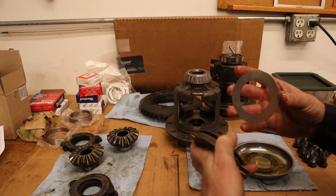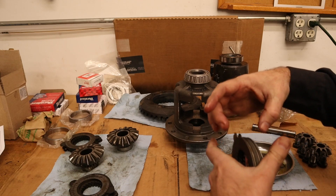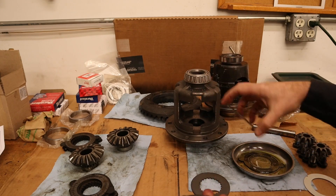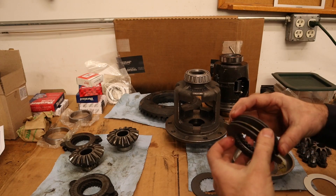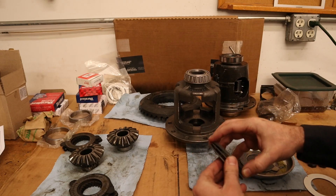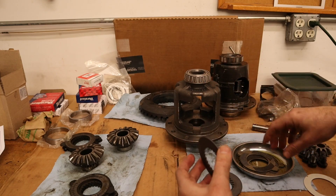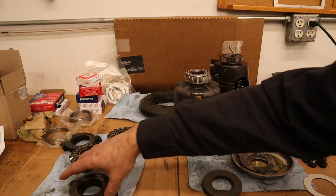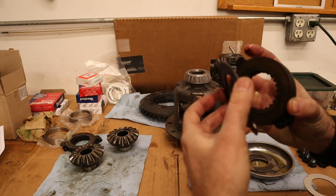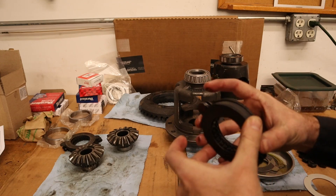While those are soaking — we have the shim, so we have the correct shim to get the thickness, which is around 0.65. We have the steel plates and then the friction plates, more steel plates, then another friction one, another steel plate. The orientation that it goes in is: steel plate, friction, two steel plates, friction, steel plate, friction, then shim — which is different than how the ones that came out were configured. This one has two steels in between the frictions.